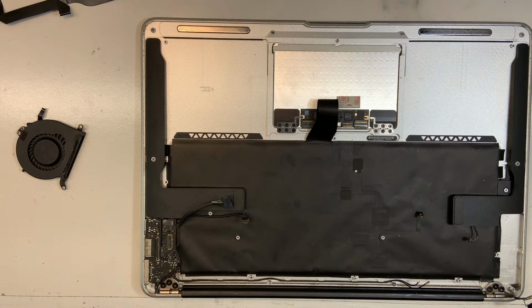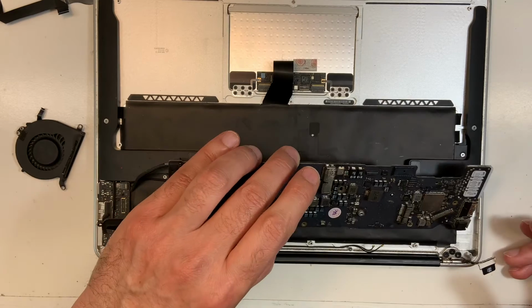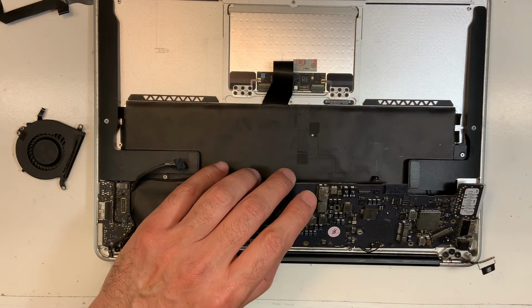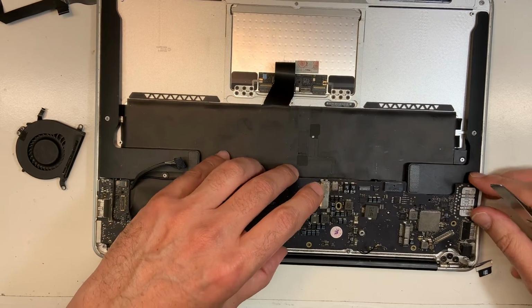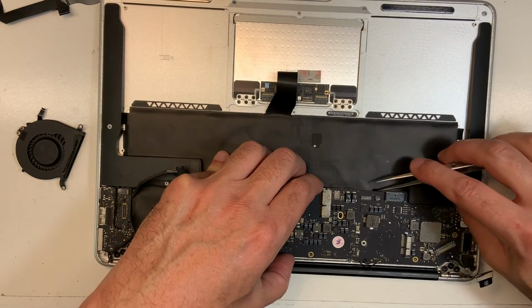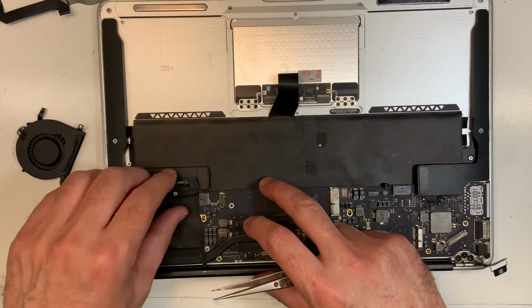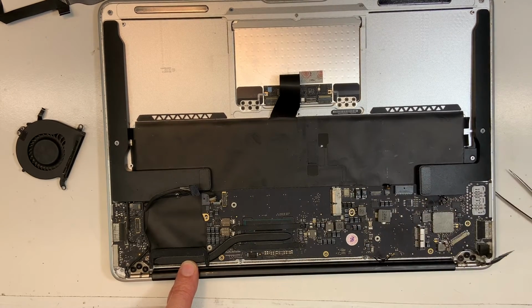Okay, now next, I'm gonna put in the board. So the board is over here. Let's grab it. Just remove a bit of dust here. Okay, so this is how I like putting the board. I go this side first. Obviously, make sure the Wi-Fi cable, the antenna, is off. The microphone, and then the backlight. On this side over here, gently, it should align properly. I'm gonna put one screw so it doesn't move anymore.